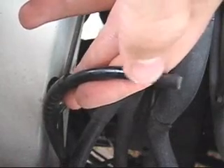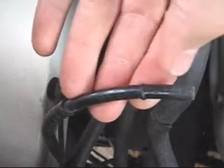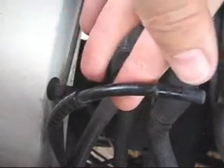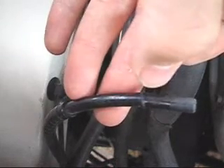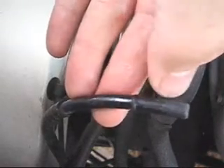This might be the cause of the leak. An O-ring is going to have a difficult time sealing on this surface efficiently. You don't actually have to replace this entire pipe — you only get one chance at this. What you can do is cut this worn part off using a special sharp razor blade tool, and you'll have a new section right behind it to seat on the O-rings. This pipe probably is in need of a cutting, although I'm going to press my luck and put it back in.